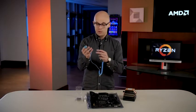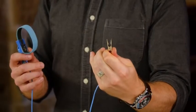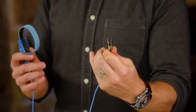You can deal with electrostatic discharge with an ESD strap. On one end there's a wristband that you simply put on your wrist, and on the other end there is sometimes a plug, which goes into a technical bench that is grounded, or there's a clip. The type you might buy from the store will probably have a clip. To use that, you turn the power supply off on your computer and attach the clip to any bare metal on the power supply. That means the static that builds up in your body doesn't go into the CPU — instead it goes through the wrist strap, through the power supply, and back into the wall outlet. That is a great way to keep your CPU safe.